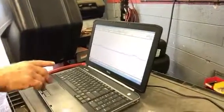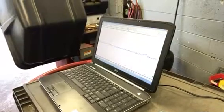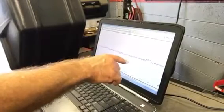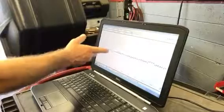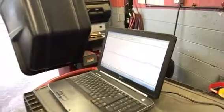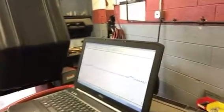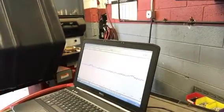So basically this is live data coming from the fuse for the fuel pump circuit. If you look at each one of these humps, I'm looking for any irregularities in the humps and how much current the fuel pump is using. Right now it's at around seven and a half amps, which is pretty normal. If the fuel pump was going bad, the humps would be spaced out — there would be long spaces in the humps and the amperage would be low.